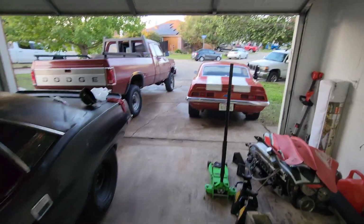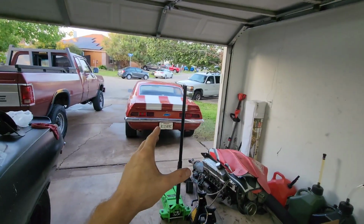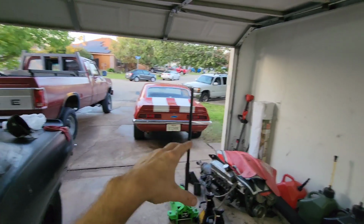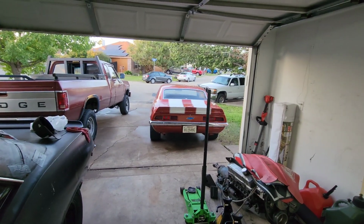I'll be back whenever, hopefully, I got this issue fixed or not. So that's it for me. The Camaro build is done on my end. I mean, the swap has been done, so that's technically what the videos were about anyways, but I'm not a drive line guru. I did everything I could possibly do to try and figure out the vibration. It is either something in the diff, or most likely the drive shaft isn't balanced correctly. It's 100% tight at the slip yoke. It's 100% tight at the rear U-joint caps. So I'm just at a complete loss.